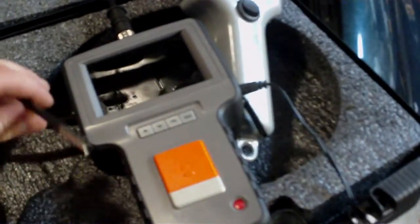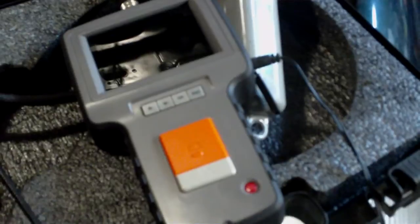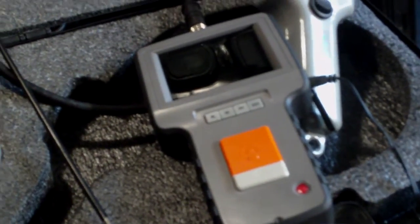I had already gone ahead and taken my downpipe off. Today I'm going to be using an endoscope, as you can see right here — it has a little camera with a light on it. I'm going to record a video. If you've got enough room under there, you can pretty much look on the side of the turbo and look at the turbine to see if you get any kind of oil leakage.